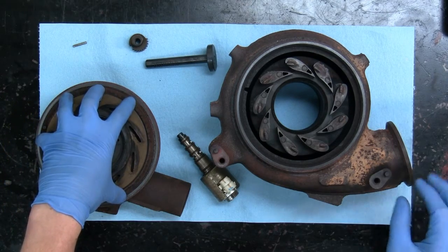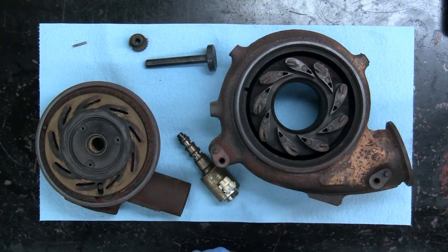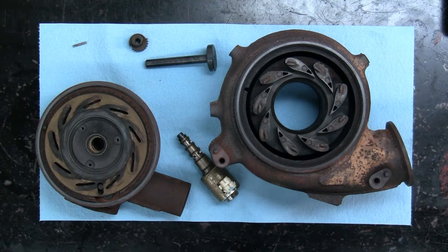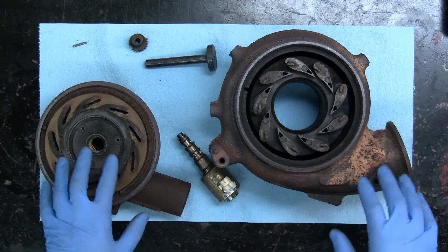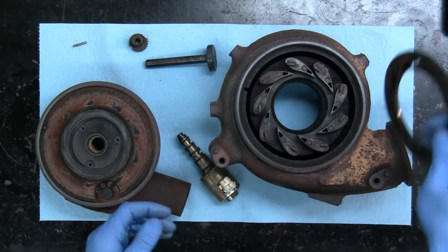As far as these turbos go, remanufactured turbos have been hit or miss. Even Ford is using International reman turbos, and they are not OE parts. But fortunately — and I'm trying to make people aware of this today — Garrett has come out with brand new turbochargers, and their latest version has 20 engineering updates. Before people get scared off by the word 'new,' these turbos are much cheaper than the turbos you can buy from Ford, and they are the OE turbo.